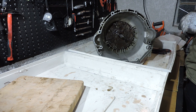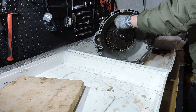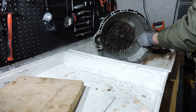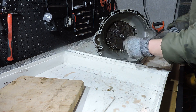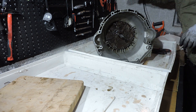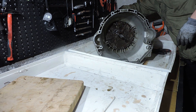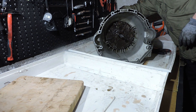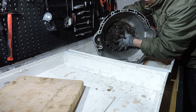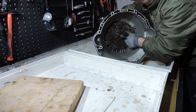The actual disassembly of the 5HP18 transmission. First we need to get the pump out. The annoying part is it has an O-ring that keeps the pump edge sealed, but it also keeps the pump nicely inside even with the bolts removed. The trick is to put two pliers with good grip on the grooves and pull it out. Another trick is to take a very thin flat head screwdriver, put it in over the brake band gently, feel where you're hitting the plate of the pump, support the housing with your hand, and push with the flat head until you feel the pump coming out.